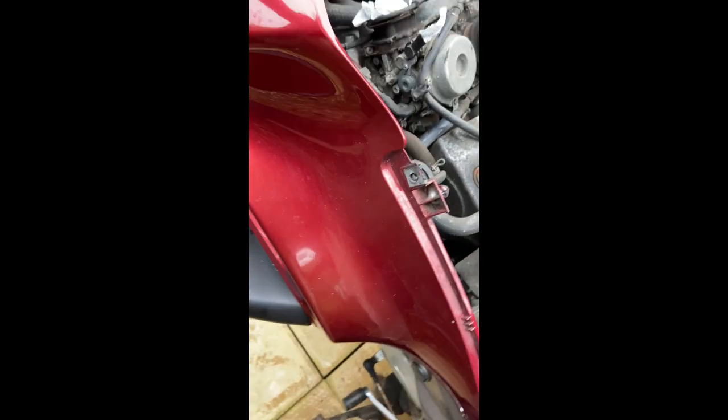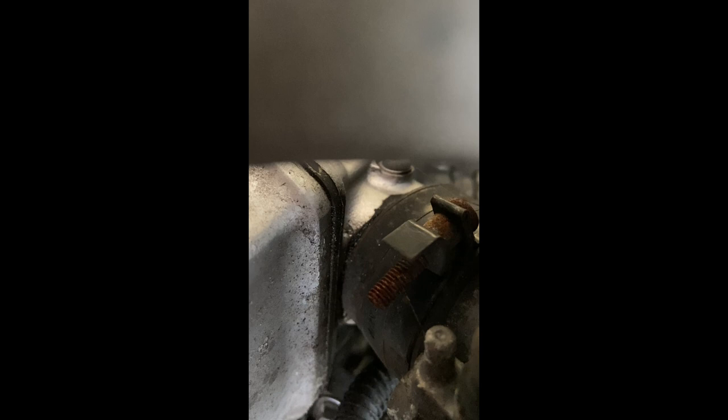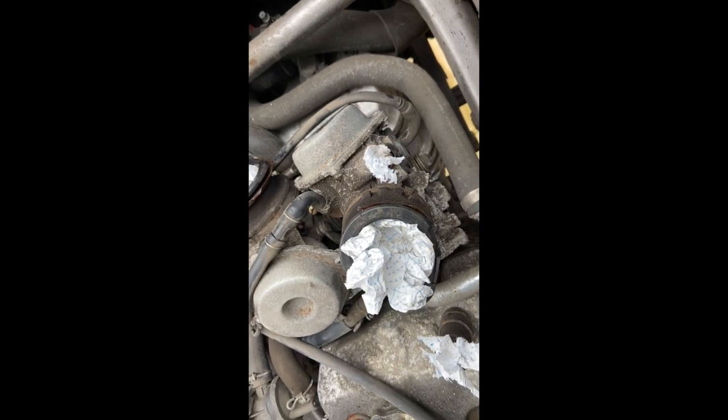Probably salt from the road, which means I've got to take this side panel off. Looking around the other side now and down under here to where the carby goes onto the other cylinder head — it's really difficult to see down in there. If I can get down in there, there's the other screw and the other insulating sleeve. Those screws are rubbish — god, they're rusted, I'll probably never undo them. That holds the carburettor onto the sleeve onto the cylinder head.